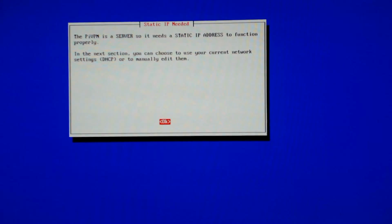But you can do reservation tables, and on any given router, you can set up a static internal LAN IP address for any given device based upon the MAC address. And so I've done this for most of my systems. Obviously, all my IP cameras are on a static IP address. That's what allows me to program an app to look for them. And I actually put pretty much all of my computers on there. Particularly, I do play some Warcraft with some friends online, and that requires a TCP pass-through port. And to get that to work, I have to have that computer on a static IP address.